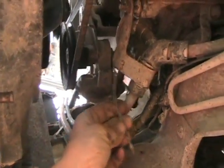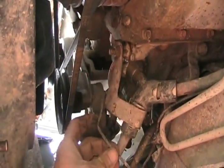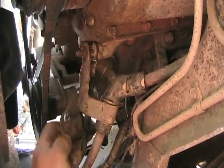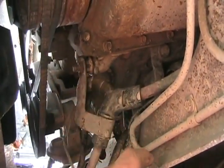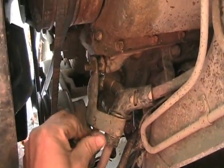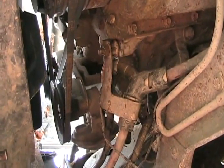The most suspicious one is the negative wire that goes to the engine block to ground, because down there is a burned-off frame ground. When that happens, the block is no longer grounding and the starter motor tries to get ground through this thinner wire that goes to the frame. It was pretty rusty, so I imagine it was all the rust between the eyelet, the bolt, and the block — which we've filed off now. We don't need a body ground to start the vehicle; it may cause weird electrical problems elsewhere, but let's see if it starts.